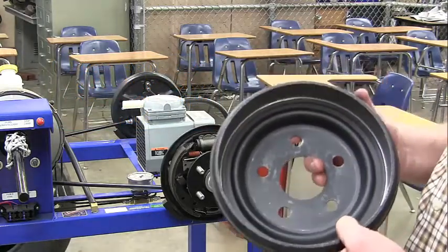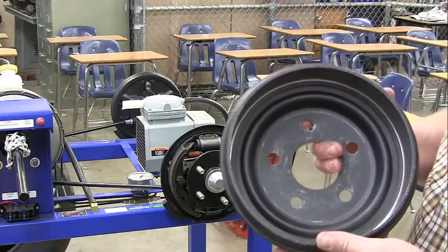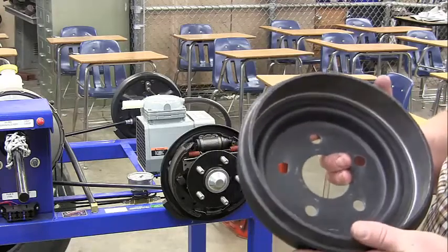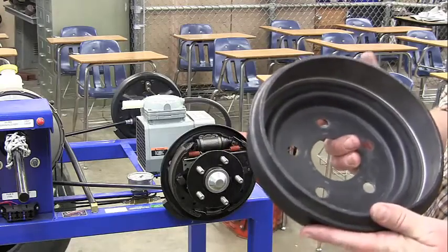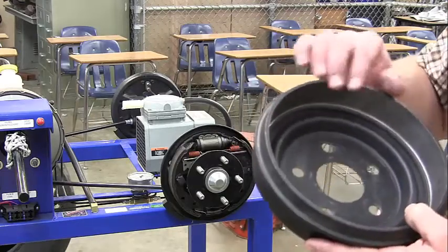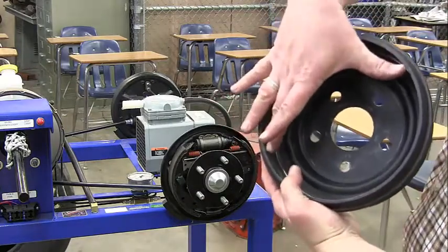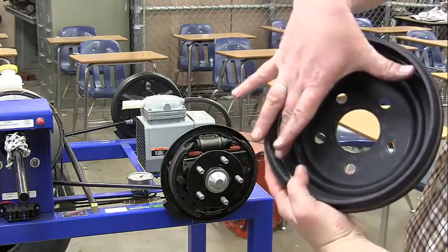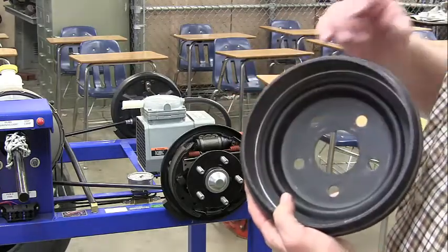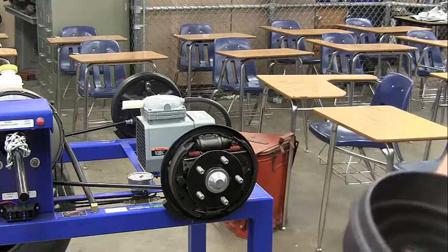On your sheet you need to look up the specs — this is off a Dodge Neon, so you'll have to look it up in the book under Chrysler, not Dodge. They only list trucks under Dodge, so look it up under Chrysler and you'll find the Neon there. It will give you the correct inner diameter maximum, and then you measure it with the tool and note that on your packet.